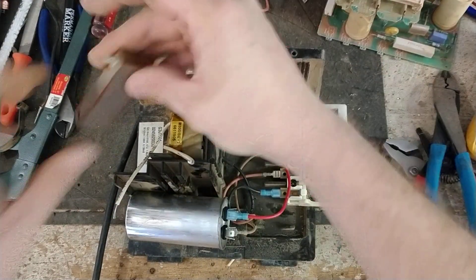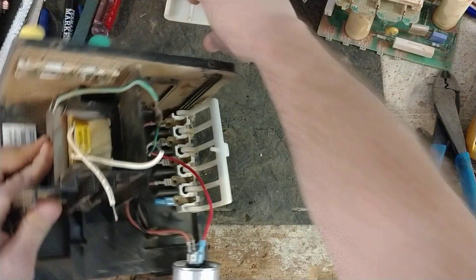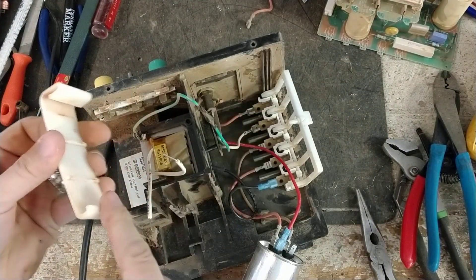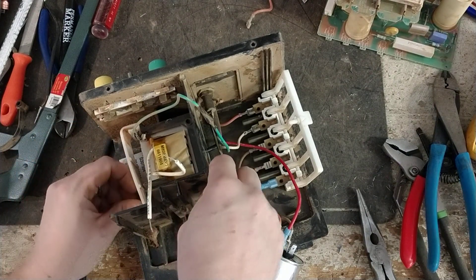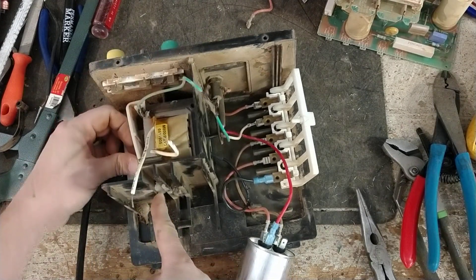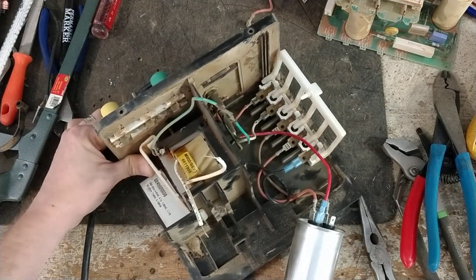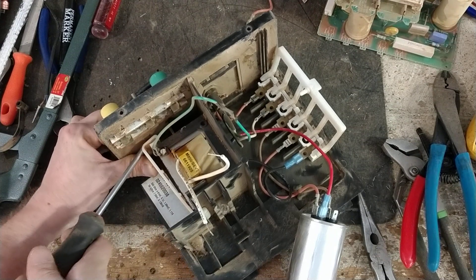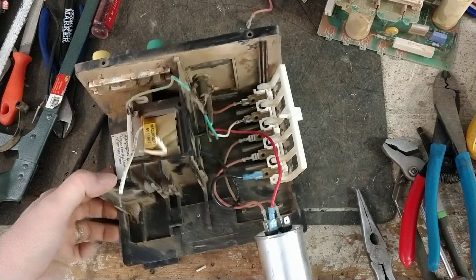We've got those other metal plates — these are going to stack up in front of the transformer. Then you need to put the clamp back in. Put this side in first; the little area is kind of notched out. Push it in so it comes out down here. Then get started with your hand and hold it, take a flat screwdriver, go between it and the case, and work it on there. That's how you get that clamp on.